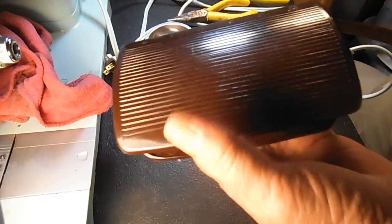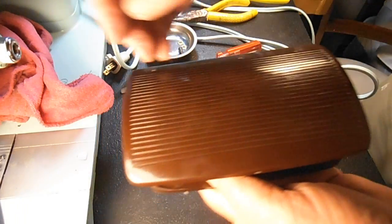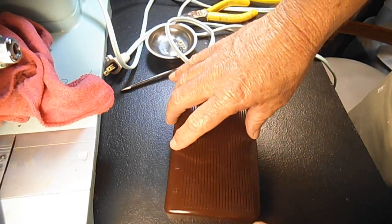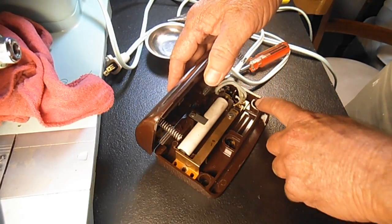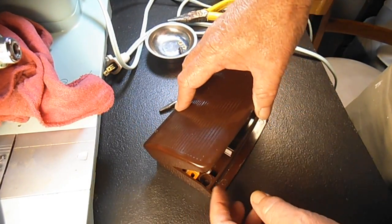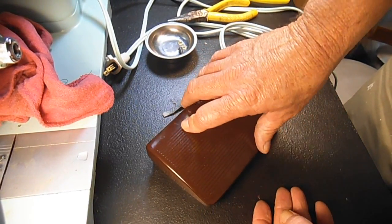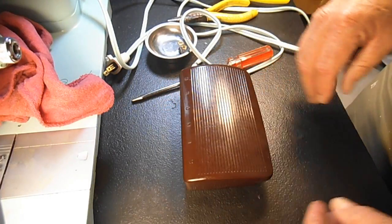And that's what, when you let up on your foot, pops this up, moving the flange back and away and lowering or stopping speed. And you hear that kind of crickets, we called it, crickets. That's the spring in the holes down there, rubbing on the plastic. So I know guys that have tried to put little cork stickers and stuff in there to help, but I don't know, when you're sewing, I don't think you're going to hear it.